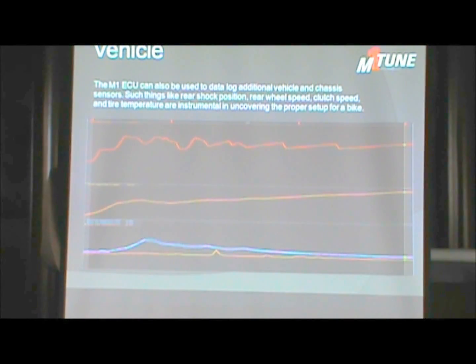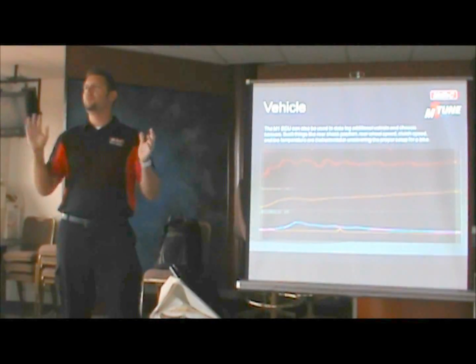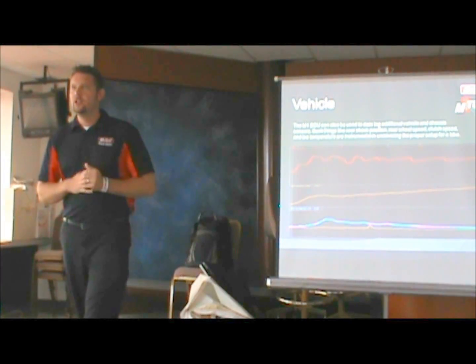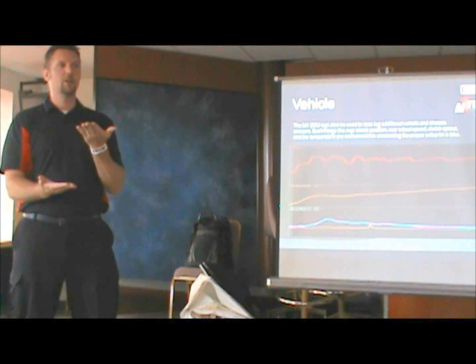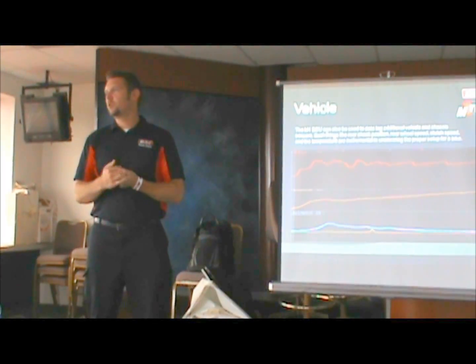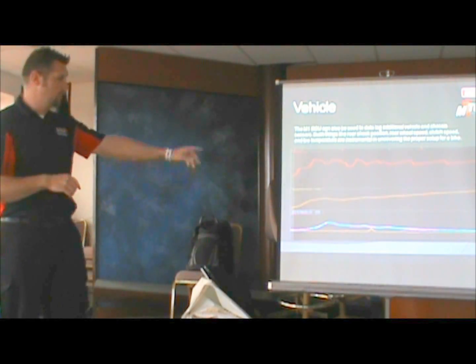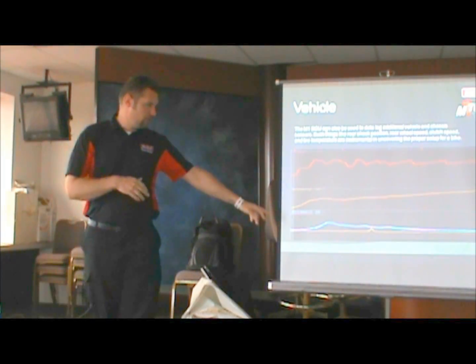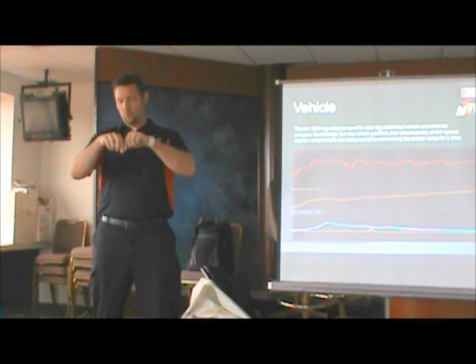So you can look at your burnout, how long you do a burnout versus what the track temperature is, and see on days where you have the most amazing 60-foot time you've ever had, what the track temperature was and how much you heated up the tire. You can start learning things like the correlation between the tire and the track and what gives you the most grip. It depends on how intense you want to get into it, but you can use things to start learning like that.